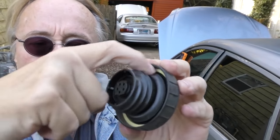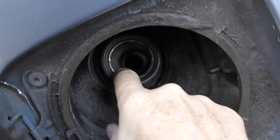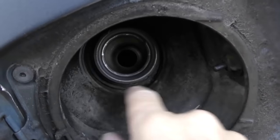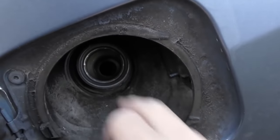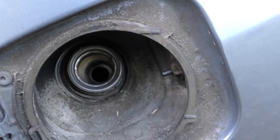As you can see right on the inside here there's a rubber seal. The rubber seal goes bad over time. Check the lid — if it's dirty or corroded you want to clean it off with a little carburetor spray so any crud gets removed and it will seal correctly. Just realize gas caps wear out over time and you've got to change them every once in a while. My advice: don't go online and buy the cheapest gas cap you can get — you're better off with the OEM ones. They're made correctly and they have the correct pressure.